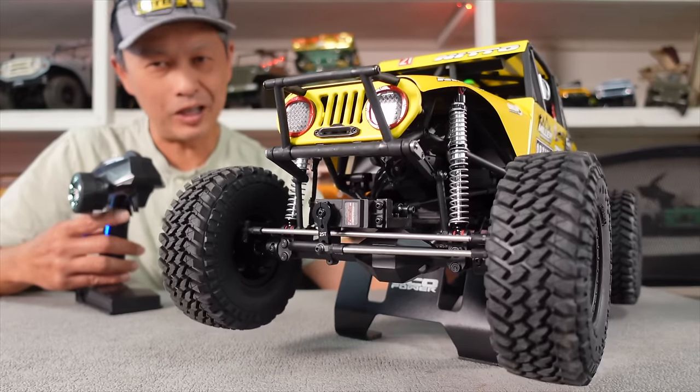As far as pros and cons: everything I've described so far is basically a pro — it's mind-blowing what they've achieved. On the con side: the suspension is too soft. You need heavy oil to get it under control; I think it's going to flip around a lot. I'm not sure why they didn't ship it with proper oil. The stock settings need adjustment: dial in the steering and get rid of that full drag brake. And the steering servo is super exposed — if you're rock racing you're going to nail that instantly — so you need some kind of guard or shield.